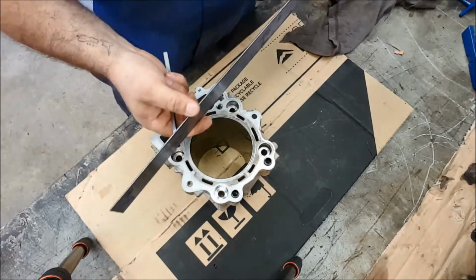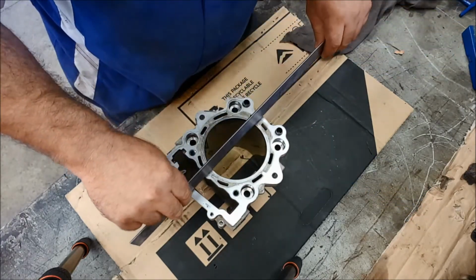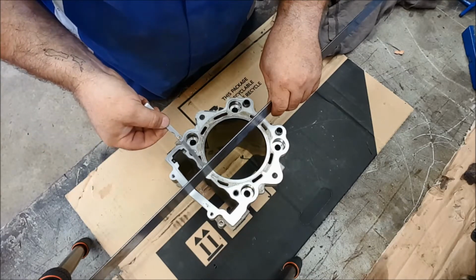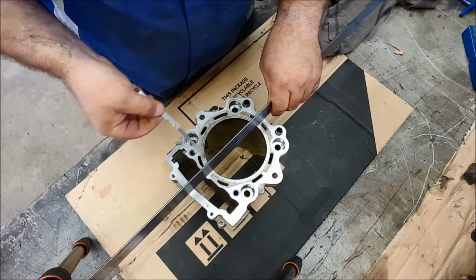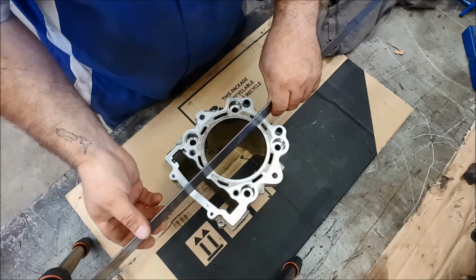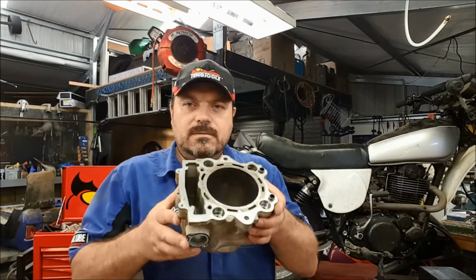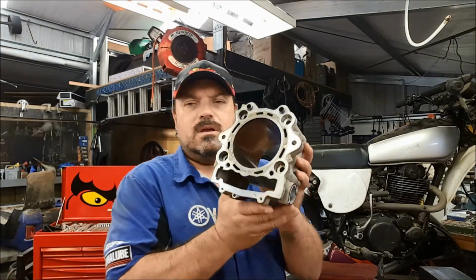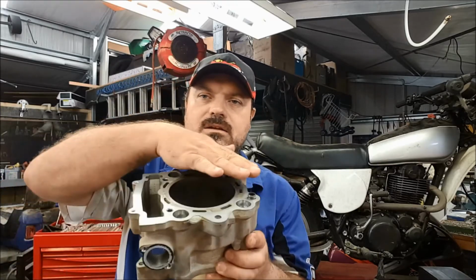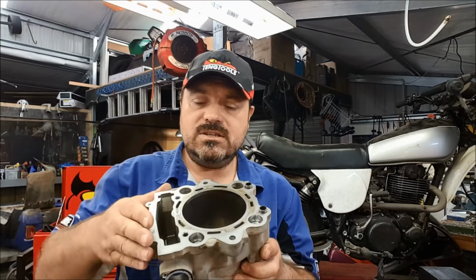Nope, that's cool. And if we turn the head round, if we do across here, great job. Okay, so that's a pass, and I'm very happy with that. So with that quick test then, I've got to hold it quite a long way up this time, we've now measured to make sure that that is still a machined, flat, within specification surface.